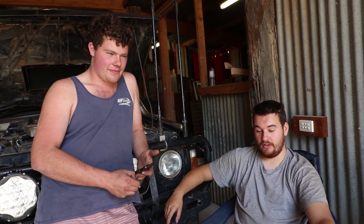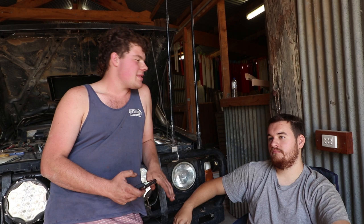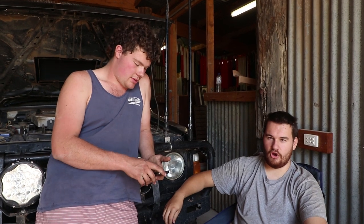I know there are people running much higher boost pressure in TD42s than us — like double us. But again, how far can you push these things? Ideally if you were going to set this up as a touring rig, you could probably run 20 pound like this with a boost compensated pump — that would be ideal. You'd get really good fuel economy and you could actually keep it in tune right through the rev range. It won't just dump fuel in at low revs with no air and roll coal — it'll be efficient.